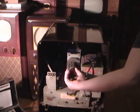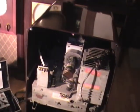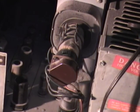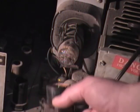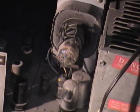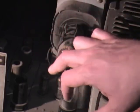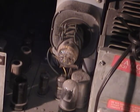I did not notice this earlier, and the owner of the set did not mention this to me, but we've got a problem. Hopefully it's not a disastrous problem. I went to remove the socket from this tube and I noticed there are a couple of wires sticking out, and I realize that the base is completely detached from the picture tube — somebody must have just shoved it back on there. That's just what happened in the last set I was working on, so I certainly have some experience with this. Let's hope this thing is still under vacuum and that the leads are still good. One, two, three, four, five — that's how many there should be. They're all still coming out.